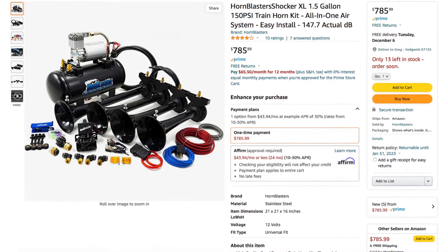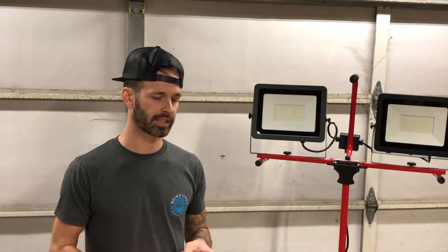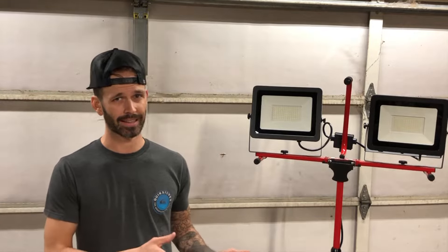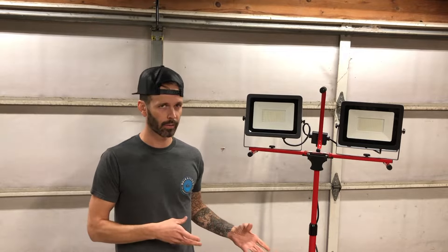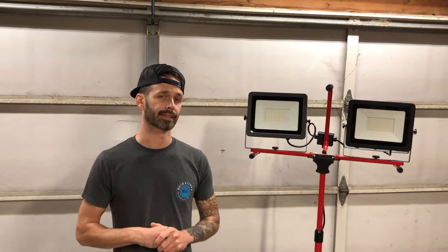So if you don't want to spend $800 on a train horn kit, this kit is a good option if you're able to keep the compressor in a dry spot. I've seen reviews where people are complaining about the compressor quitting, and I believe that has to do with people putting the compressor on the outside of the vehicle — the compressor's not supposed to get wet. The HornBlasters kit can handle that, but it'll run you $800. We're installing the compressor in the trunk so we don't have to worry about water. We run the hoses and wires through a grommet to the horns on the outside of the car, so if you have a place to keep the compressor dry, this would be a good kit for you.